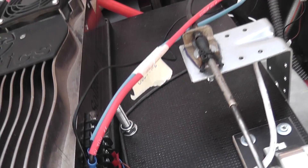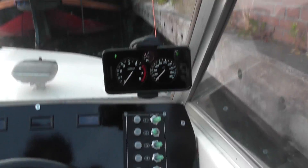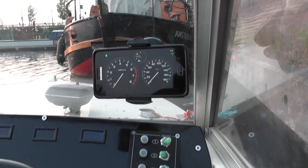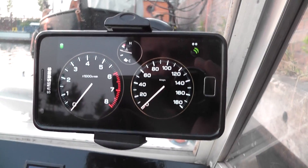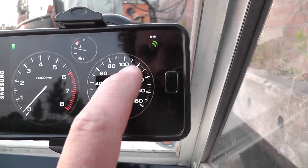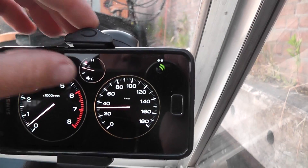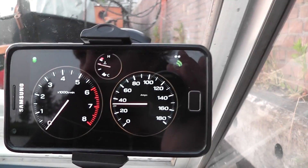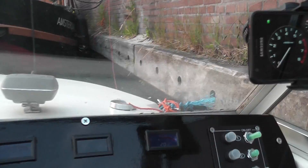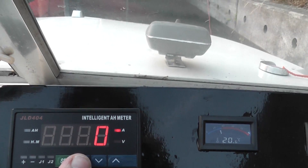The Soliton comes on — it's on the same power leads. That Wi-Fi router has a little Wi-Fi network, unsecured, that communicates with our Android phone. In the future we'll have a tablet with more space. But for the first time now, we have it in neutral. We have RPMs — that is 620. We have motor amps — that's 32 amps. And we have controller temp at 22 degrees Celsius, which will add to our data set along with the battery box temperatures and our shunt, giving us pack voltage, pack amp hours left, and pack amps.